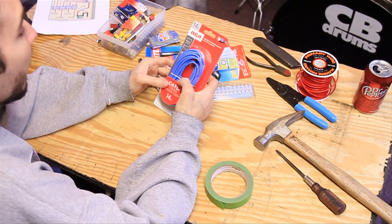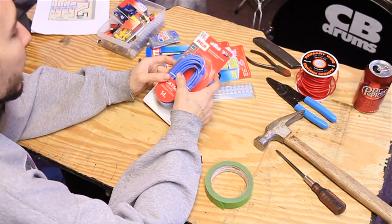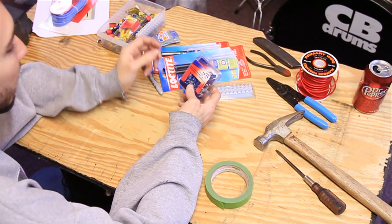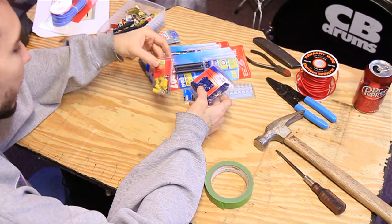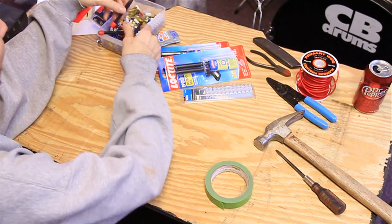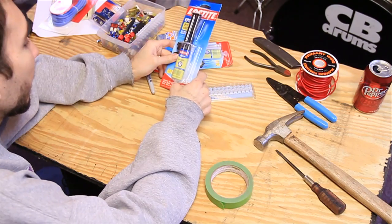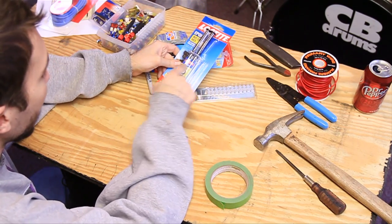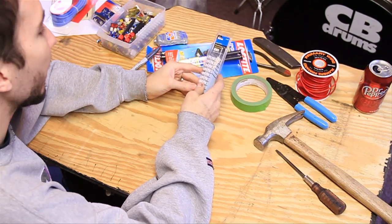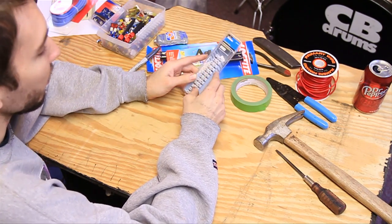The next thing you'll need is a Cat5 cable - that's going to run to your switches, so you'll need to route it into the cab. Usually 7 feet is good enough, maybe 10 feet depending on your run. You'll also need a bunch of female connectors - I've got the 16 to 14 gauge blue ones - and some yellow ring terminal connections. You'll need mini flathead screwdrivers, dielectric grease, epoxy with one minute setup time, a Sharpie, tape, and a barrier strip - I got mine from Lowe's for about eight bucks.